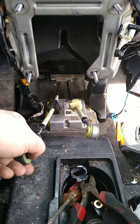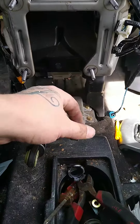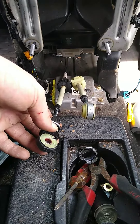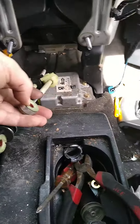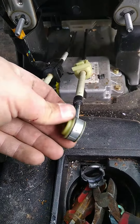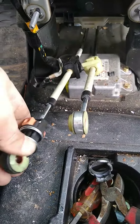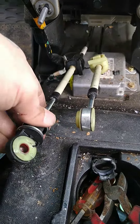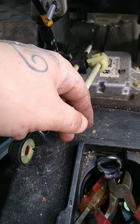The main reason I made this video is because of these shifter assembly cables. I accidentally chipped this one up a little bit — luckily it'll still hold for a while. I could not figure out how to get these off, and I haven't worked on a vehicle in a little while, so I was confused and nobody really explained it online. So here it is: they just snap right off. You just got to get them evenly pressed off while the assembly is still attached to the housing.